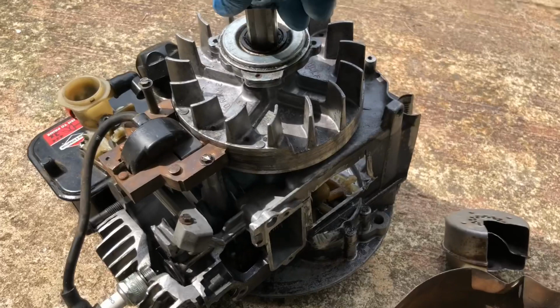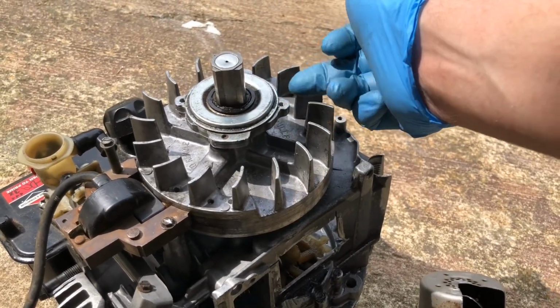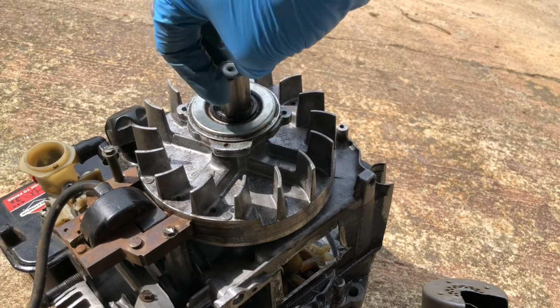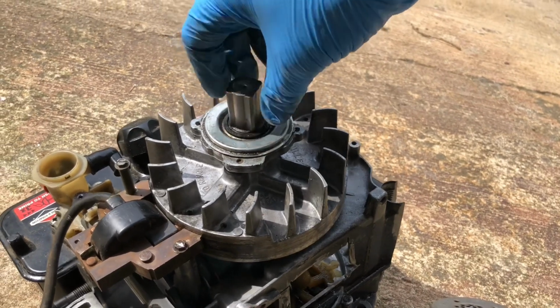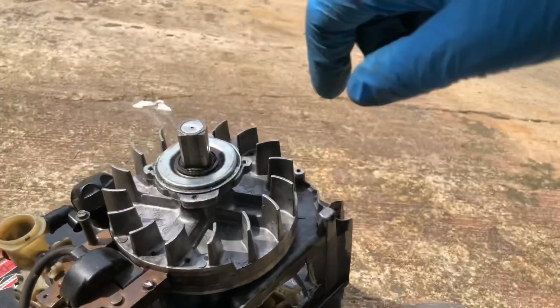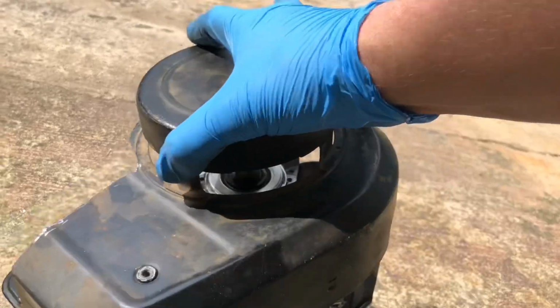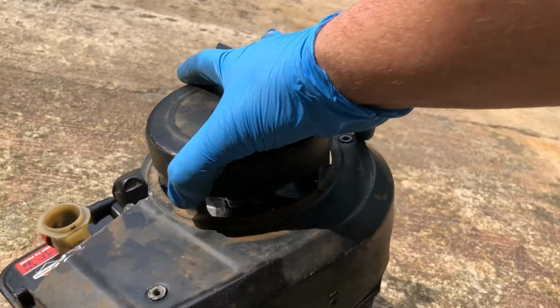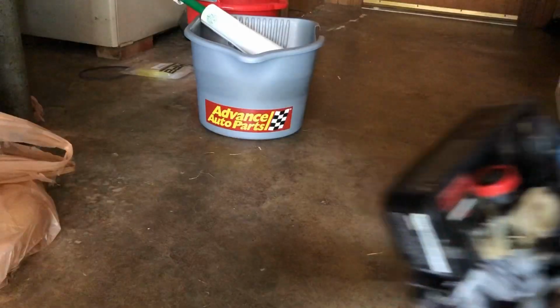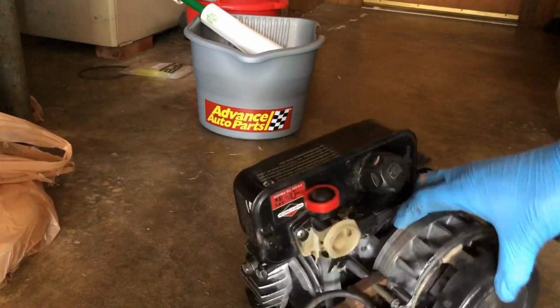It turns this, which is a ratchet mechanism. On this particular one, it works with ball bearings down in little grooves, and if you turn it to the left, it spins freely, but if you turn it to the right, it locks on, because that's the way the engine spins. So I'm going to go ahead and stick this on and demonstrate both the blower housing and the spark plug. So this is about the darkest corner of the garage I can find at the moment.